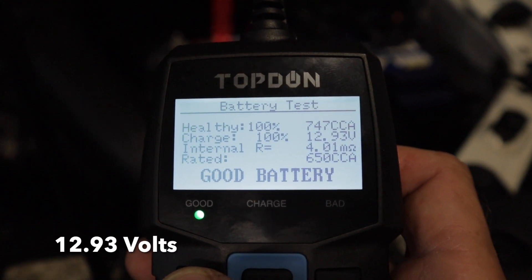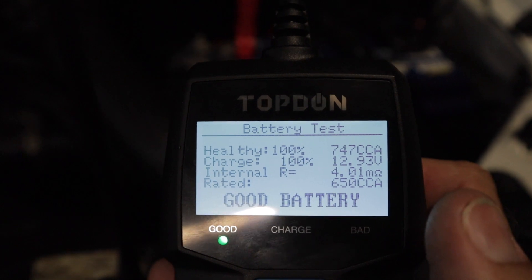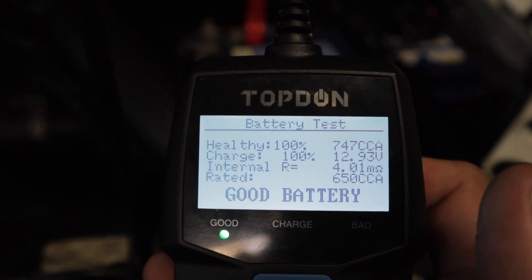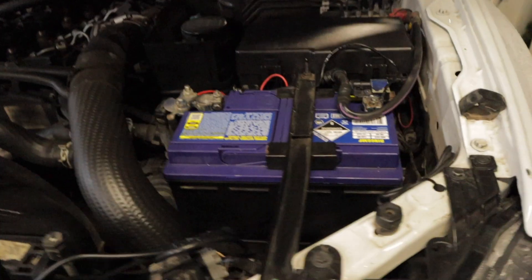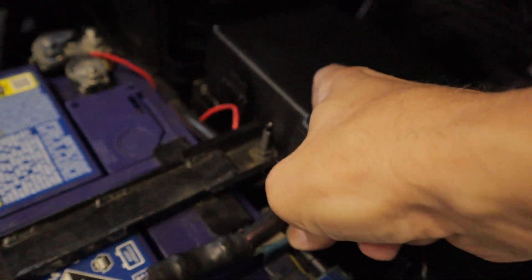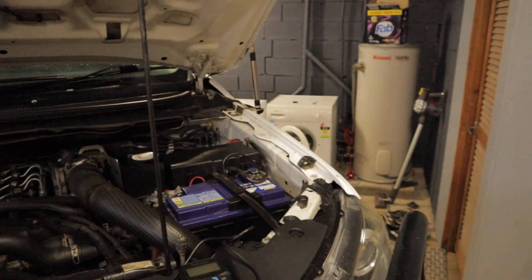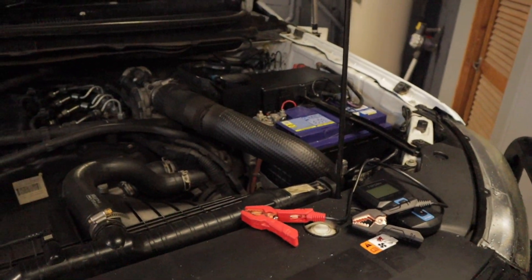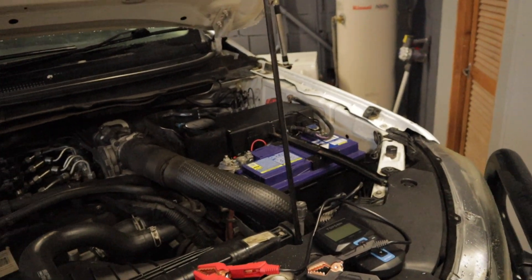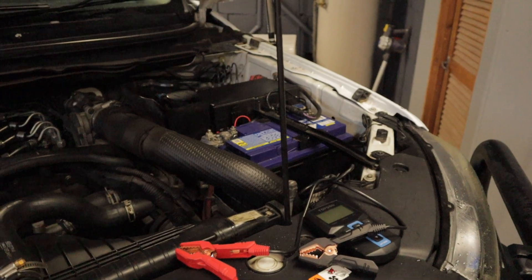As you can see, our battery is now back at 100% and sitting at 12.93 volts. No doubt with a bit more driving — I only took it out for a 20-minute drive — it would be well into the 13-volt range at the battery. Big increase there. To plug the smart charge back in, all you do is slide that back on and you're done. It's a good little hack to keep your battery fully charged, especially for camping trips or work sites where you're running a radio or CB radio, instead of it regulating down to around 12.5 volts.